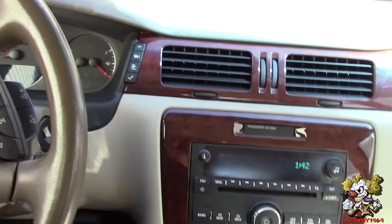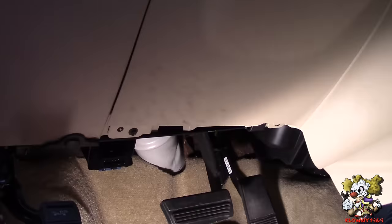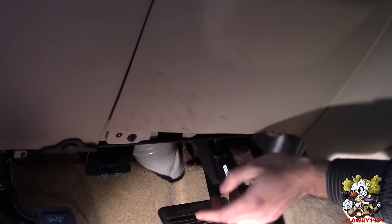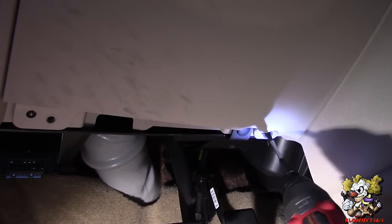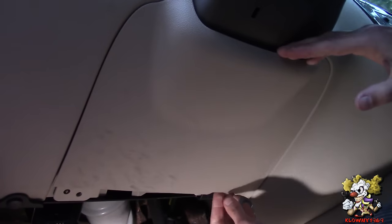So that's the sound — let's get to it. Underneath the steering column you have two bolts here; it's either 9/32 or 7 millimeter, you can use either one, or you can use a Phillips head. I'm going to go ahead and take these off — that's one and that's two. Now I just got to grab this and pull it off.